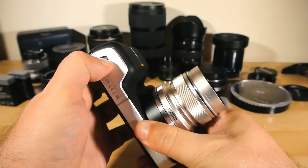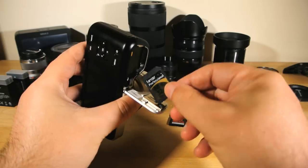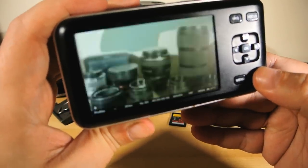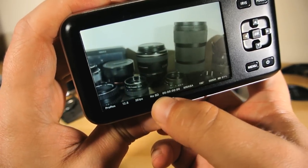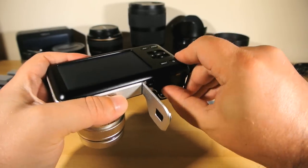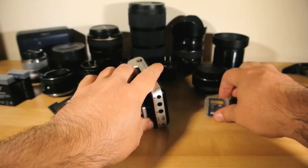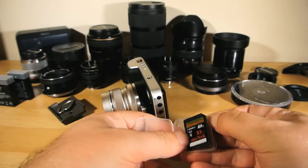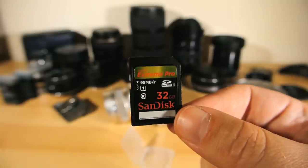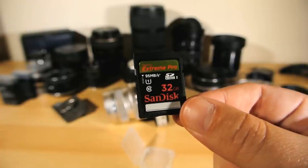Back to the SD cards. The camera is very picky when it comes to memory cards. It will refuse to recognize some SD cards altogether when you shove them inside. Others may be recognized but aren't quite fast enough to keep up with the very large and demanding data rates required, causing dropped frames and frustration. Now, let me be clear — this is not a flaw with the camera. It's a flaw with some memory cards. Some are just crap, and some are deceptively labelled, talking about their peak data rates and not the sustainable constant data rates, which may be very different things. The ones I've been using with a 100% success rate are the SanDisk Extreme Pro cards. They're easily one of the best, most reliable, consistent cards you can buy, which is why they cost more. But in my opinion, it's an investment in a worry-free filming future that is absolutely worth making.